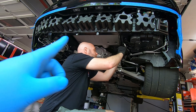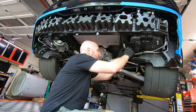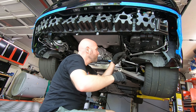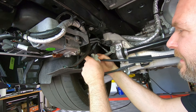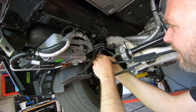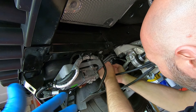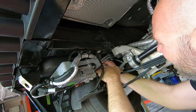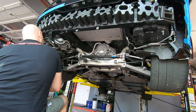He's just zip-tying the NPP wires out of the way. Taping them is a redundancy thing — there's really not a reason to do that unless you're worried about the connection getting corroded, since those aren't used for the new system. The AWE kit comes with some heat shielding that you're going to put onto the transmission cooler side, which is the driver's side — wrapped to prevent any overheating issues. We obviously want the transmission to stay as cool as possible, especially if you have an automatic.